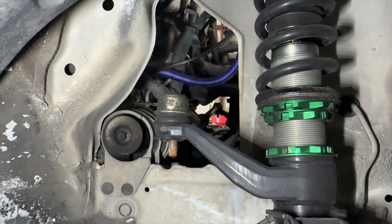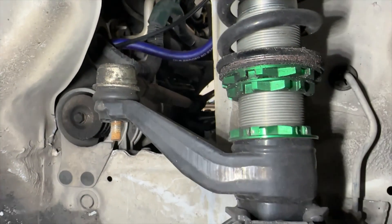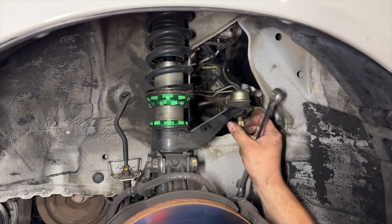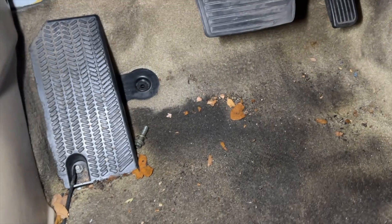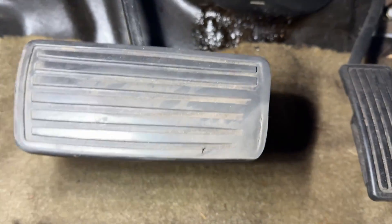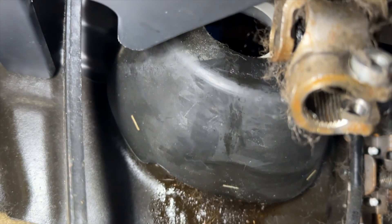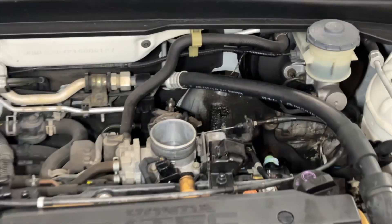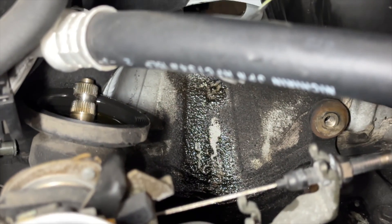The plug hole is on the bottom so the rack should have plenty of room to come out. Once you move this arm out of the way the whole thing should come out of this hole. You can see how much fluid has been coming inside the car — it comes behind the carpet and saturates it. It's been leaking for quite a while; you can see on the firewall where it's been leaking out the rack, coming from here and leaking under the carpet, making a big mess down the front side too.